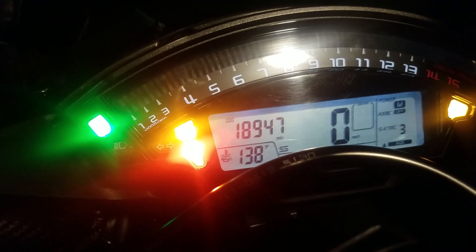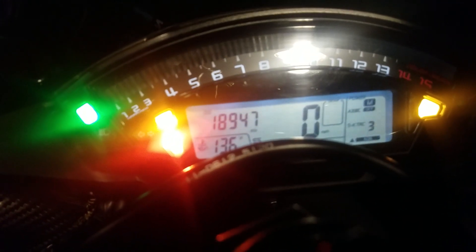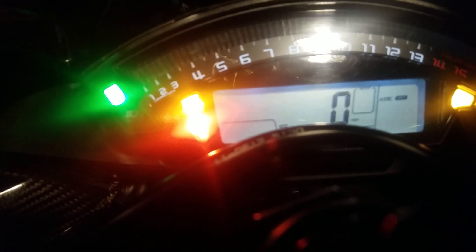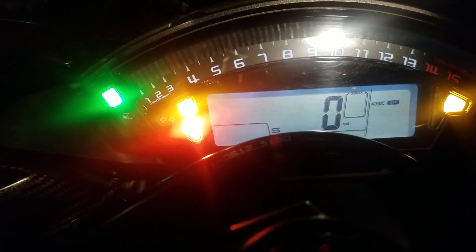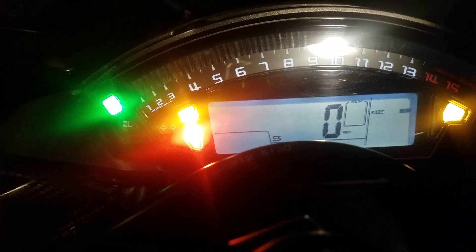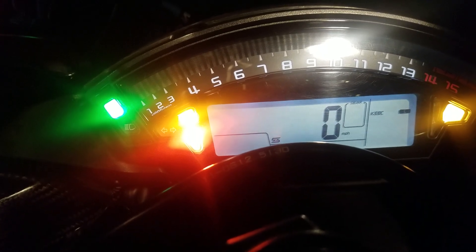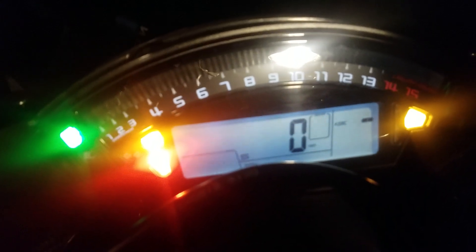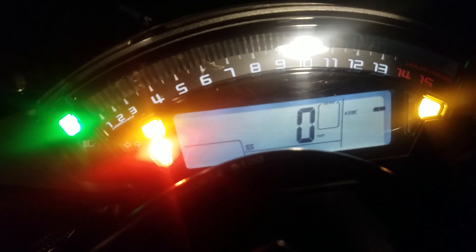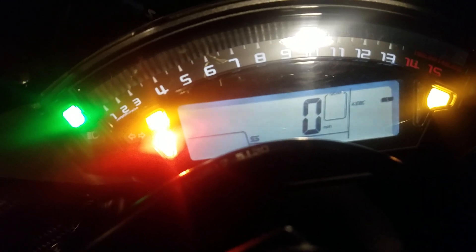When it's in the on position, there's only a setting for low. So going into Kawasaki engine brake control, right now it's off and the only other setting is low. In the low position, this limits engine braking, so if you're on the track you have less braking force as you come to a corner and slow down — this actually helps make your lap times quicker.